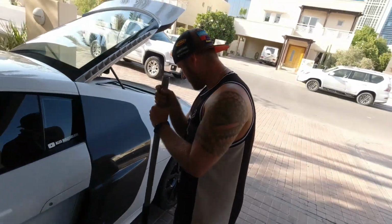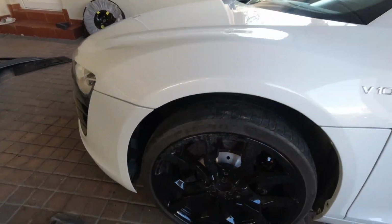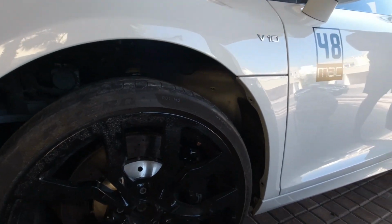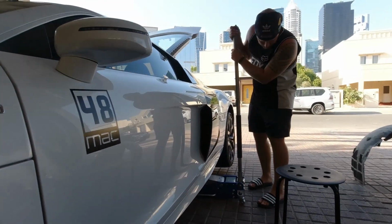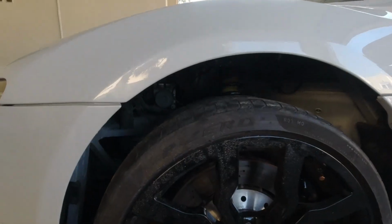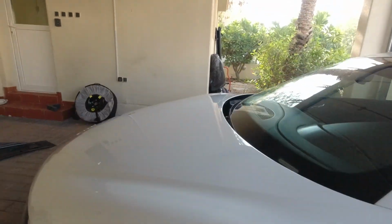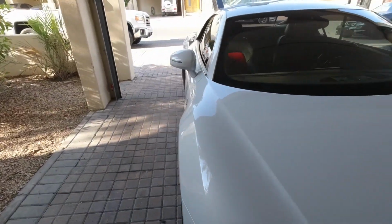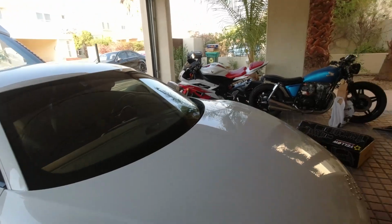Okay, so basically, up next, what are we doing? Checking ride height. So, put the wheel on. Four bolts should be enough. We're going to drop it and see what the current adjustment is on the coilover, so we can double check if we need to lower it or not. Let's see what the stock settings of these shocks was. Not too sure. Well, three fingers. What's the stock height on the other side? It's higher. Yeah, it is.